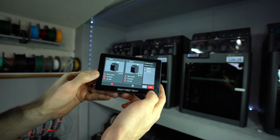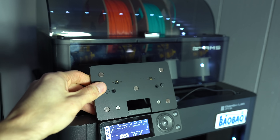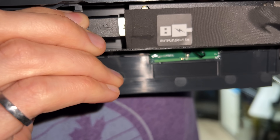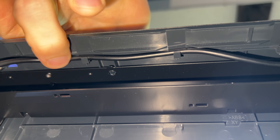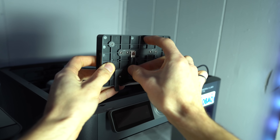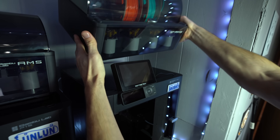The screen itself is portable and has a 30-minute battery life. You simply need to toggle from printer power to battery power and you can take it with you. If you are mounting it on the printer, you'll first need to remove the AMS and the top glass in order to gain access to the inside. The supplied cable gets plugged into the 5-volt USB-A power port on the inside frame behind the stock screen. The cable is routed through some cable management clips and up through a cutout in the frame — it really feels as if the printer was designed with this upgrade in mind. The USB-C end of the cable gets plugged into the back of the charging dock, then we peel the backing off the adhesive and stick the bracket to the frame above the existing screen. And that's the installation complete.